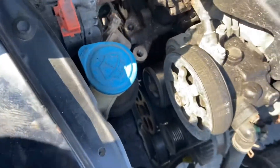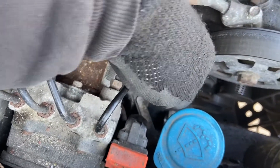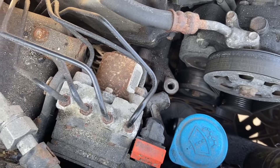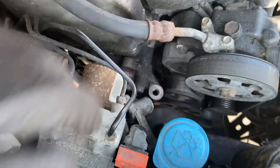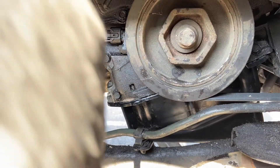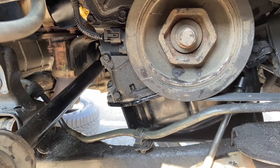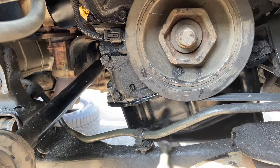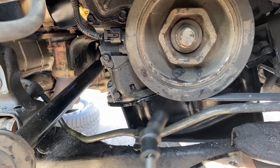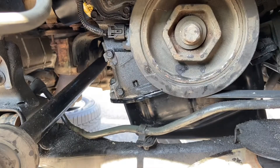This is the engine mount on the side — this is the only one I took out. Just this engine mount alone, and I was able to do the job. I'm going to put some oil in the car now. And this right here — this is the tool I used. This wrench was really helpful — see right there — it has a swivel head, so you can direct it whichever direction you need. Really helpful. Don't forget, these three bolts on this side are the longer ones. And you can see my jack stand is still right there.